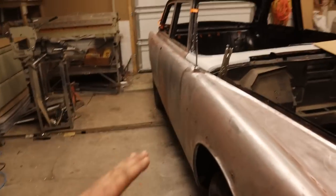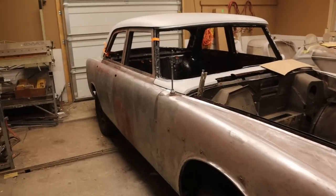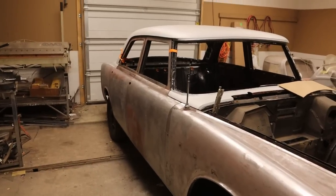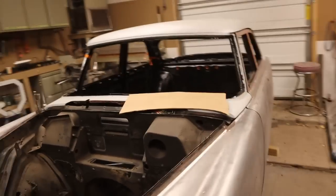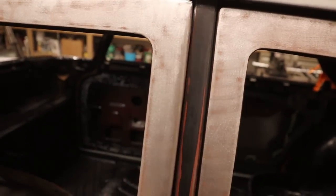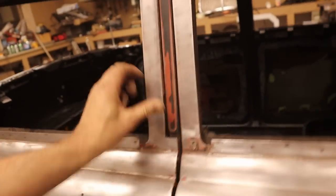This is the side of the car that was hit, so this side is going to be a real challenge to make look nice. I'm feeling pretty good about it so far though. Okay, let's get busy. I'm gonna start with the top of this door, number one. There's my repaired door corner, and now you can see we have a nice even eighth of an inch gap. I wish it was more, but instead we're really fighting with this center one here, just trying to square this up.